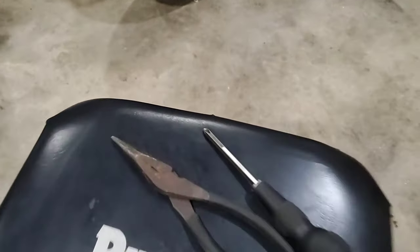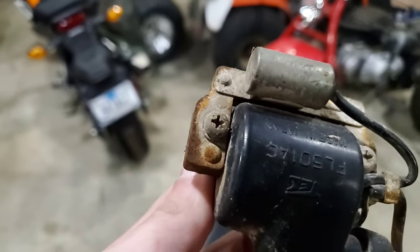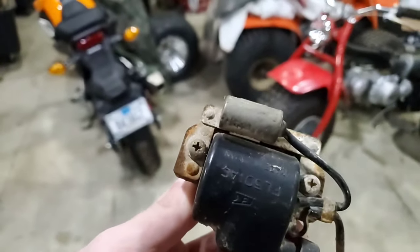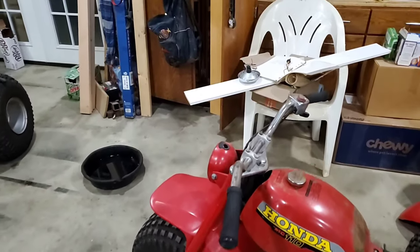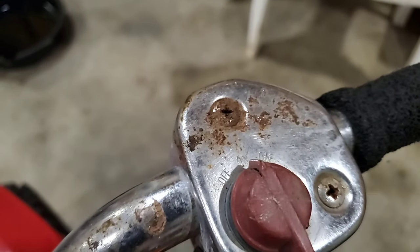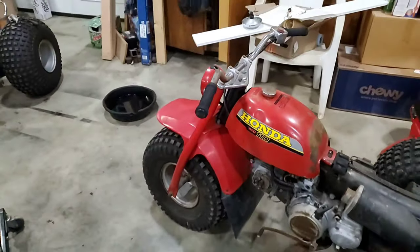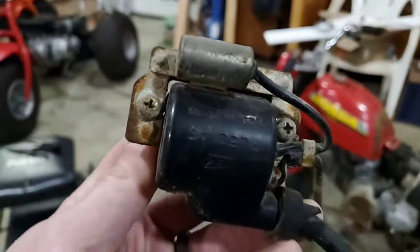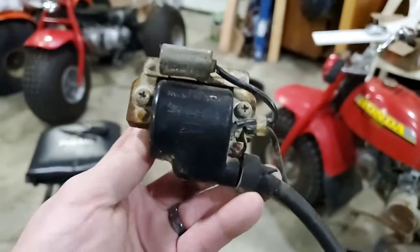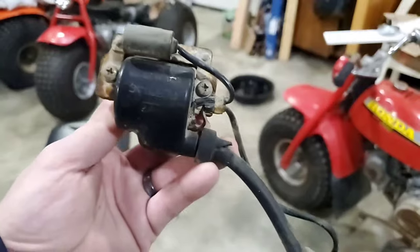So the fitment of this tip as a JIS in that screw head is 200% better than a Phillips head screwdriver. So when you're working on these and you'll see Phillips head screws all stripped out, when you get your screwdriver out, you're like, oh boy, I hope she doesn't strip out. With a JIS, it bites right and saves you so much headache and hassle. Like when I put the screwdriver to these screws out there, which have been on there for 41 years now, they resisted up to that point where you hear that, and then it just unscrews.